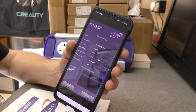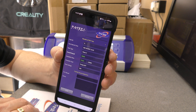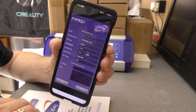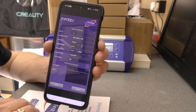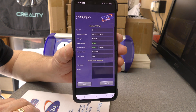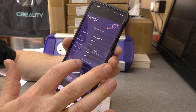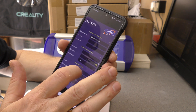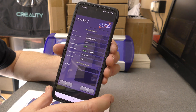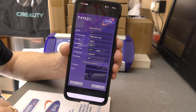This is quite handy, actually. For me, I film all the repairs, but the PAT test is off to the side so you can't see on camera whether it's a pass or fail - it's really just down to me to look at the green lights. In theory, as we're filming, we could hold the phone in front of the camera, run the test, and type in the order number as the appliance ID, then show the results on screen - giving us a physical video record of that.